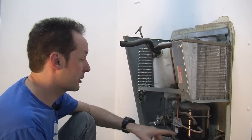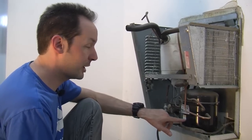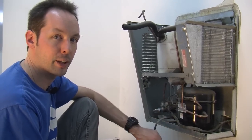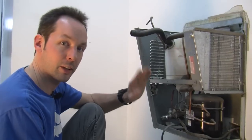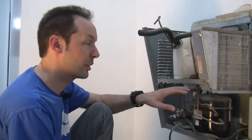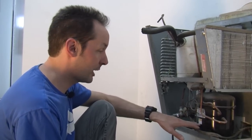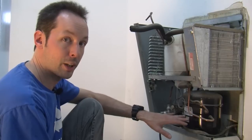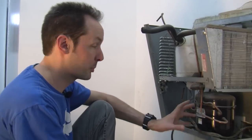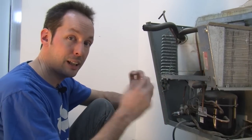So what's happening here is we have a compressor down here that's taking the refrigerant, which is basically a liquid like Freon or something that'll really happily, handily change from liquid to a gas and back and forth at a temperature and pressure that's convenient for this kind of application. But this compressor is compressing the gas form of R134A into the liquid form, and when it does that, it makes a lot of heat. Okay, so we're putting mechanical energy into it, and we're getting heat out.